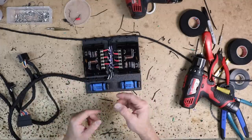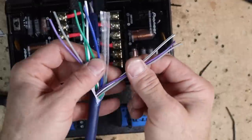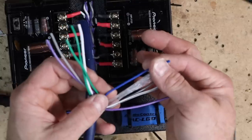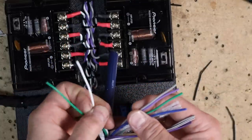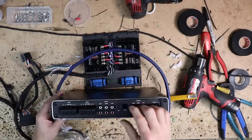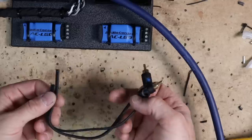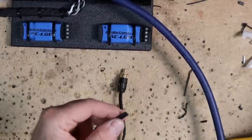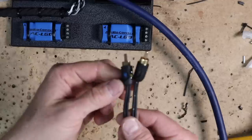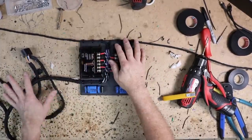You have your double-color wires — solids and stripes. For this install, we'll be running two runs of speed wire. Back at the amplifier, because this particular amplifier doesn't have a high level plug and uses RCAs, we'll be using the Stinger X12 line — designed specifically for this. On one end you have a male RCA, on the other end you have a set of speaker wires marked positive and negative. We'll solder these onto the ends of our speed wire and then plug them directly into the amplifier. It comes in blue and black — we'll need two pairs, one for front and one for rear.